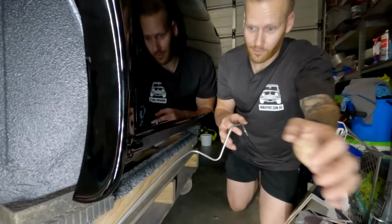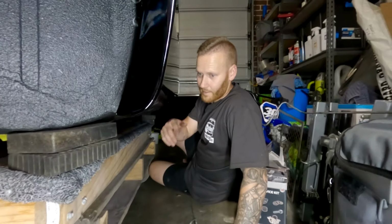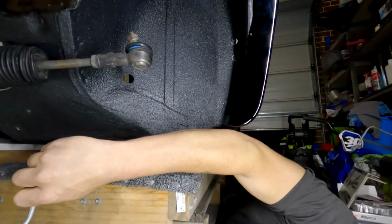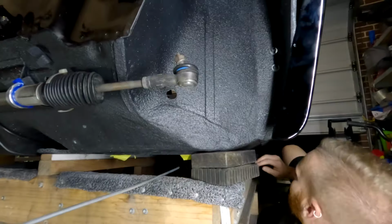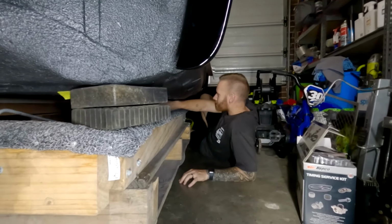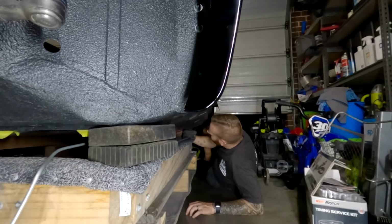All right, so next thing is the fuel line. What we're going to do is feed it from the front, just because the front kicks up a bit and we won't be able to get it all the way through from the back without bending it. So hopefully, feeding it from the front, we should be okay. We'll probably just put it in there, give it a bit of a twist, I reckon. There we go. Just guide it all the way back. So exactly the same as the brake pipe. And then when it gets to the back in a second, we should be able to manipulate it around. Bang, that's it. That's pretty much it.